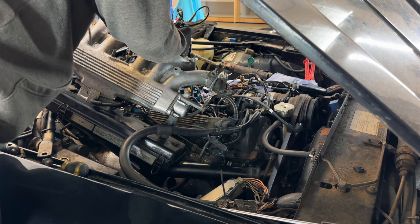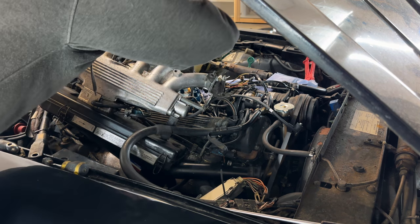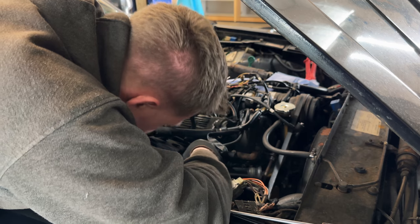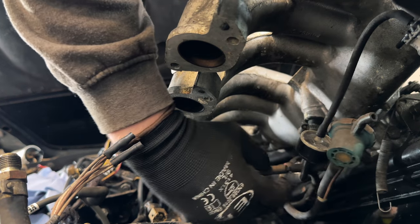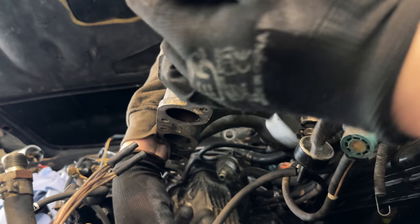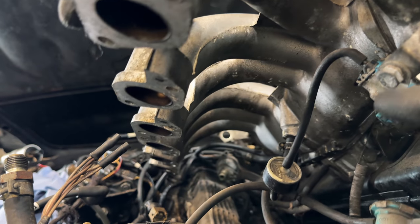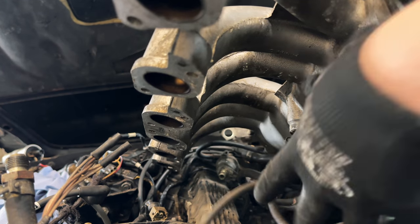I'm going to mark one of these lines. That should just come out. That's the wiring out of the way. Loads of lines in the back of this one - there weren't so many in the other one. As you can see there is loads of stuff under here. This one comes across to a vacuum line of some sort - it goes to the bottom of the ignition coil. I'll have to take this whole lot off in one go because there's a bolt on the side there that I might be able to get off and then take the whole lot away. Off that bolt comes, underside of the manifold near the bulkhead.